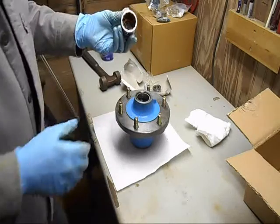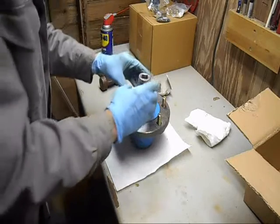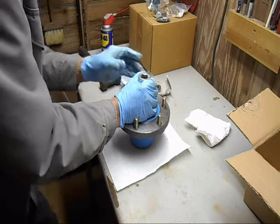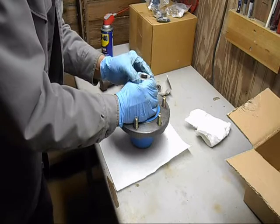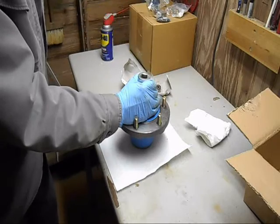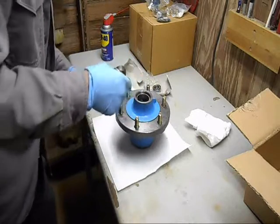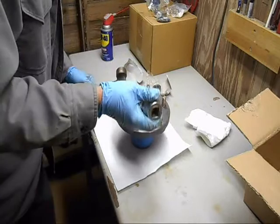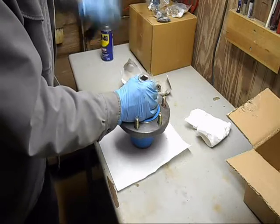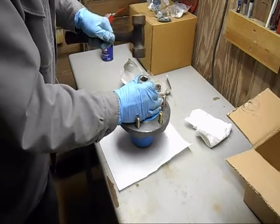And then the old mechanic's trick was go find a socket that's large enough to line up perfectly on it. And line it up. Hold it pressed down. You don't want it to bounce. Alright, got it centered, press down, and hit it. Because you are literally driving that race into that area that's designed to receive it. You'll feel it when it gets solid.